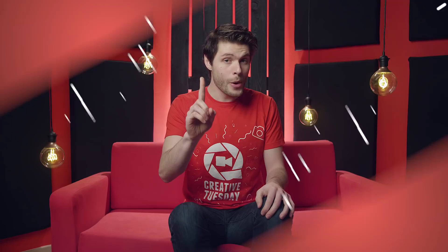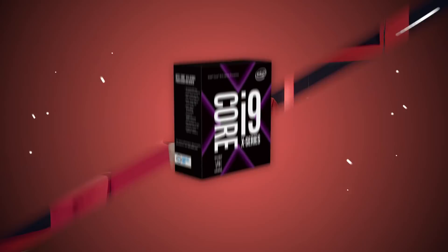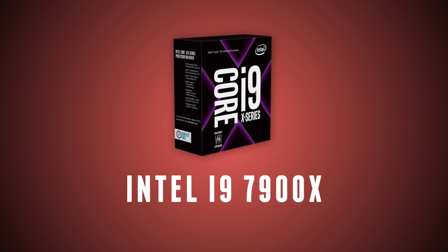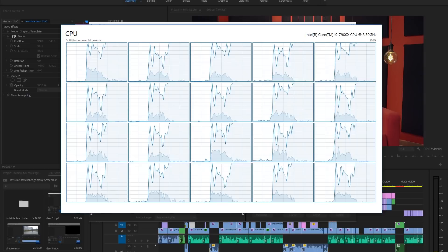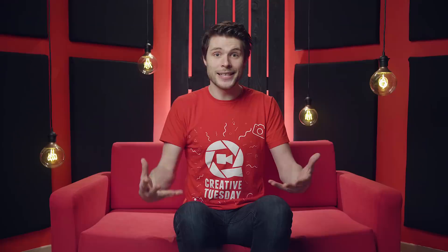Do, however, check your video editing software first to see if it's compatible with a dual CPU and the amount of cores you're about to install. Always remember that the software is the weakest link in your setup. Our system came with the Intel i9-7900X, which is a 10-core CPU running at 3.3 GHz — a beast of a CPU giving us extreme performance inside Premiere Pro and when exporting a project. You can see it very clearly in the task manager how Premiere Pro is utilizing each core. An Intel i7 will definitely work superb for 4K editing too, and there are even a few i5 processors with 6 cores I could recommend. I would not go below 4 cores unless you're not planning to edit 4K footage anytime soon — ideally, you want to sit around 6 to 8 cores.